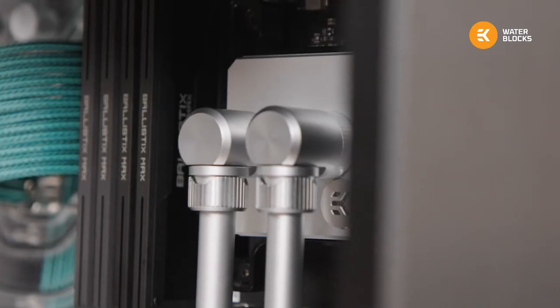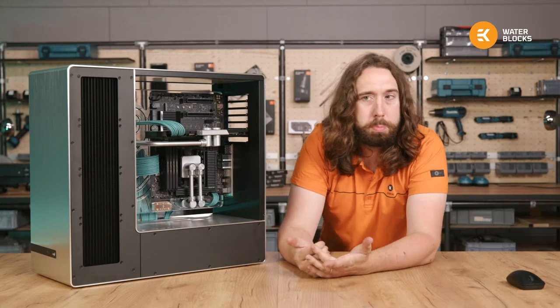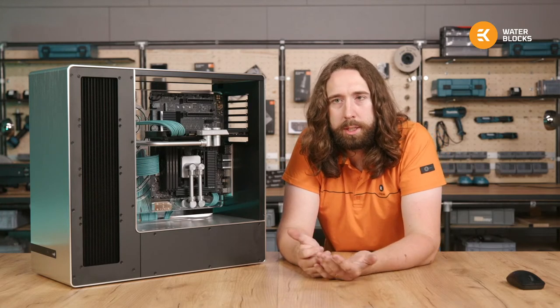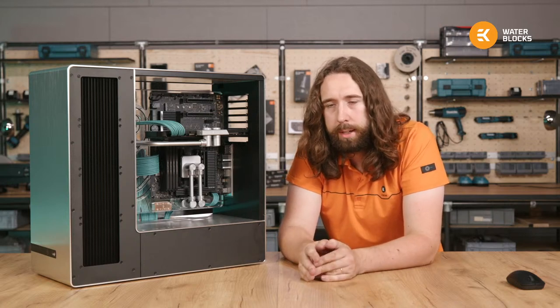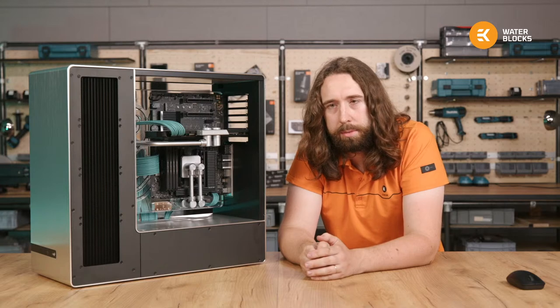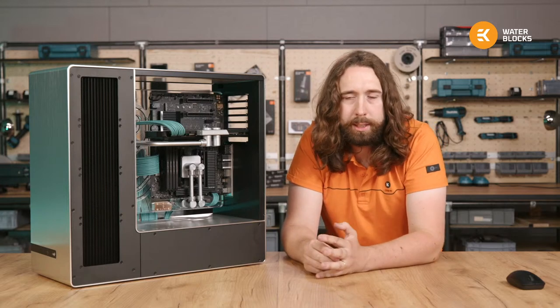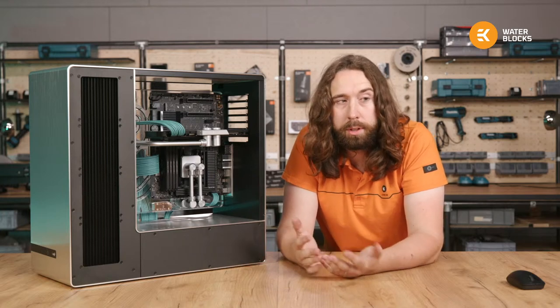Host, temp sensors to control fan speeds. I personally don't like them. I don't like fan speeds being controlled. I'd rather they were just continuous. When you have an overkill amount of radiators especially, then there's really no reason to ramp them up. Like the airflow, because it's over such a big area, is always high, even though you can't hear it.